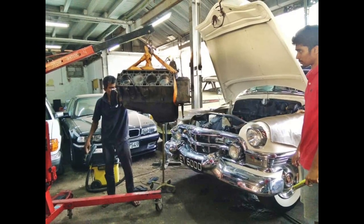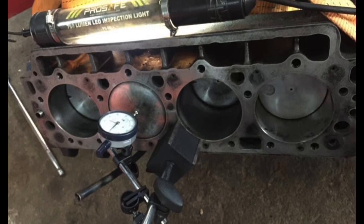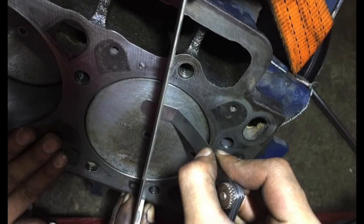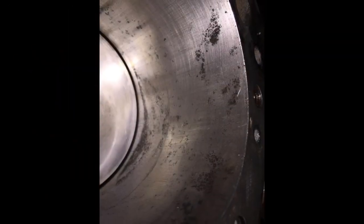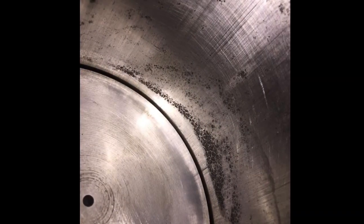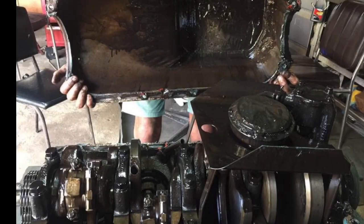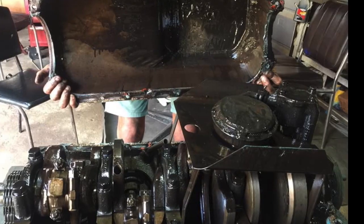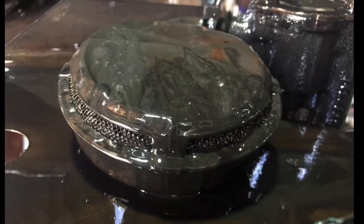So the engine had to come out. When we investigated, we found that seven pistons were alike and the one that was different was a larger bore size and also did not come right to the top. The cylinder of that different piston was badly corroded. At the bottom end, there was a lot of sludge in the sump and in the oil pump.